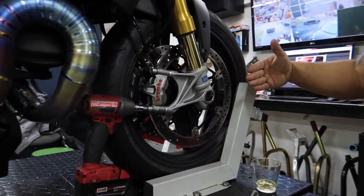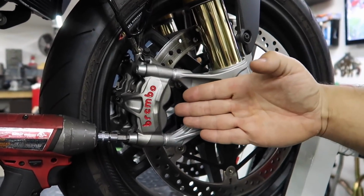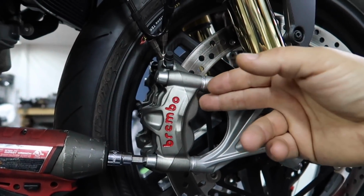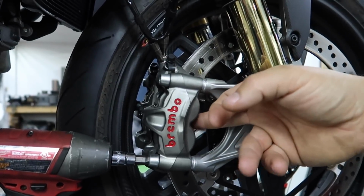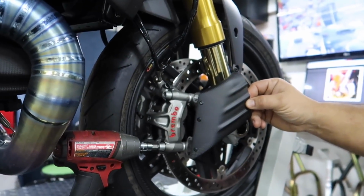So anyways, what that essentially is supposed to do, it's not really just for looks. It funnels that air and pushes it right where the braking surface is. Most of the surface tension between the pad and the rotor, that's where all your heat is for your brakes. So it keeps both sides cooler, if both sides of the rotors get cooled as you're moving.